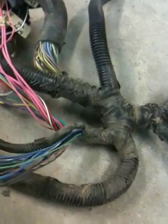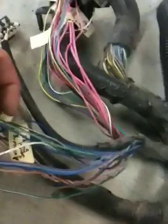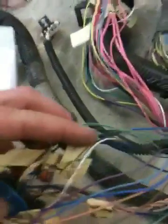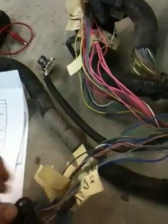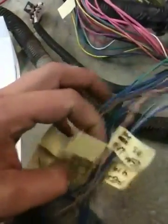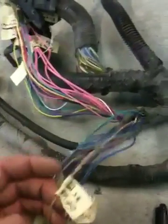Of course there are grounds all over the truck, but they want one that's contiguous with the engine. We have an AC low pressure switch that comes through here — it probably goes to an HVAC module. And then this one is the accessory wake-up serial, which is part of the GM low speed LAN, I believe. Then we've got the GM LAN high speed interface — you can see it's twisted here. This is the GM high speed LAN.